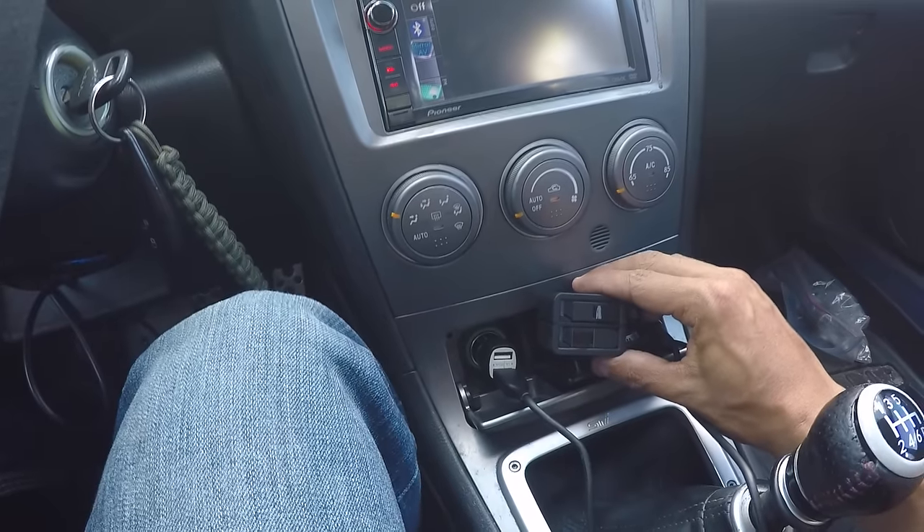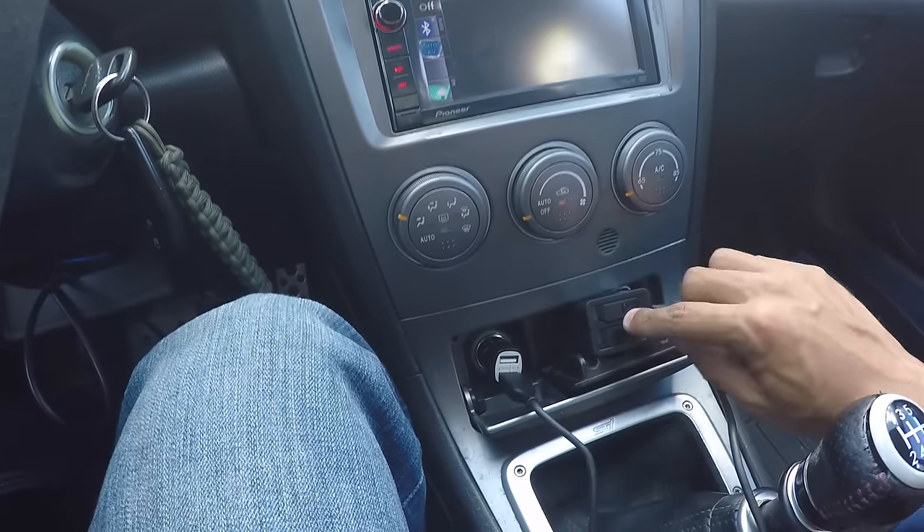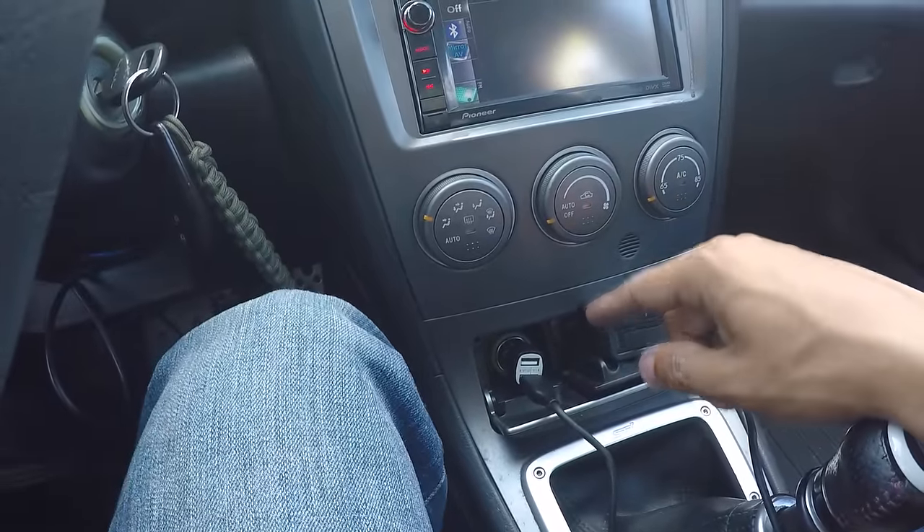You want to make sure that you replace this short little wiring harness and reconnect the clips and this light. But I still don't have any power, so that tells me there is some other issue going on with my electrical system, at least in regards to this outlet. So that does not fix my problem. But in case you ever have to replace a cigarette outlet on a Subaru, that would be how you do it. It turns out I have some issue going on other than my cigarette lighter, which is fine — I haven't noticed any other electrical issues with this car, so it can't be that serious. Sometimes you try to fix something and it doesn't work, or you realize that wasn't the part that's broken — that's how it is fixing cars.